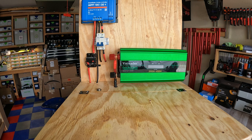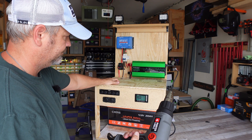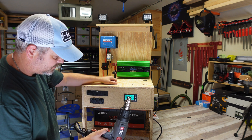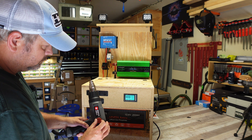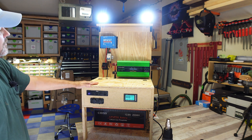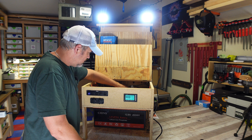Let's turn on the inverter and get some things running on it to make sure everything looks good. Starting with the heat gun test — plugged into the inverter. On low, according to my battery monitor I'm pulling around 450 watts, 35 amps. Let's boost it to high — we're pulling 1,555 watts, holding steady at 12.9 volts, outputting 119 volts on the inverter. Let's turn on some lights too. I hate running these tests with a heat gun because it's so hot, but it's a good test for the battery, inverter, and the whole system. Cable and fill is fine; I think we're good.